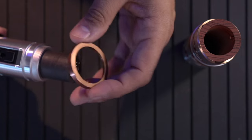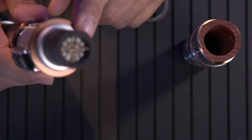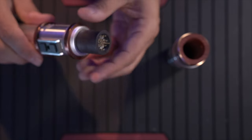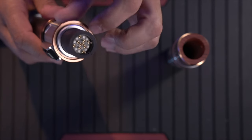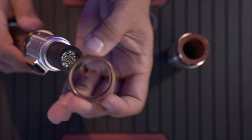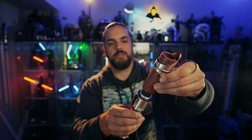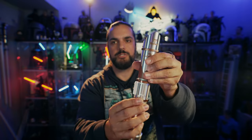So I found that if you put the groove side in first and you leave the flat side facing up, this is how it worked best for me. Simply because if you do the other way, the timing shims are just falling into that groove and they really don't do anything. So you wanna flip this upside down. When this came in, it was backwards. You may have seen the short that I put out. It was backwards and it's supposed to be like this.